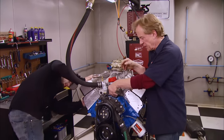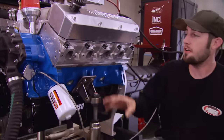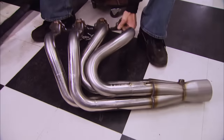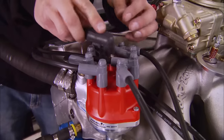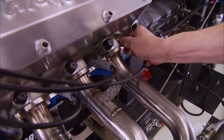When we come back we'll get the headers on and see if this motor runs as wickedly as it looks. We're just a few steps away from firing up our Ford 460 big block, which has gone from strictly budget to strictly bad to the blue oval. We had the guys at Cook's Custom Headers fab up this killer set for us — stainless steel with two-inch primaries that poke out like a metal octopus. Finally, a new set of plug wires, eight-and-a-half millimeter MSD Superconductors, and we're popping them on some E3 spark plugs that might add a few ponies to our horsepower tally.